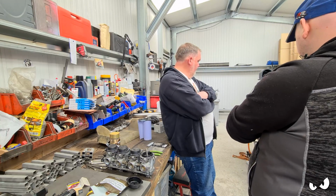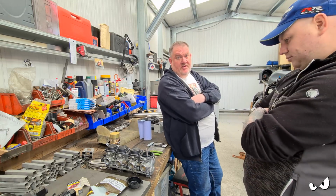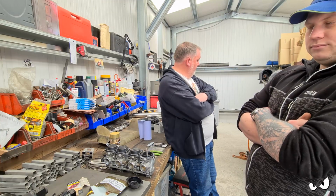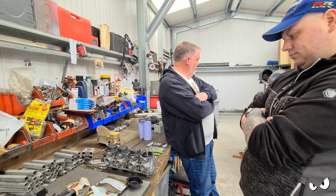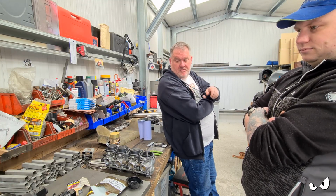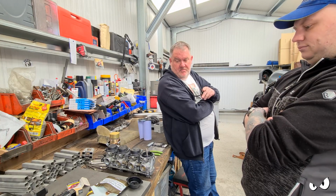And we can do a lot of colour tune to get the air fuel mixture in the ballpark at idle and everything. Like you say, you're never going to know it's right until you stick it on a dyno. So let's just go stock carbs, get some different boots, we can go from there. And there's no impact on changing the carbs at this stage as far as fabricating stuff on the bike goes. It'll all just bolt on.